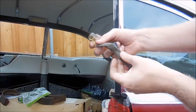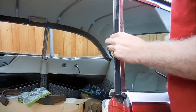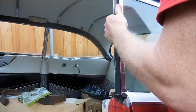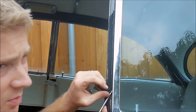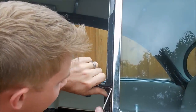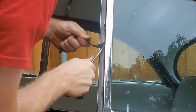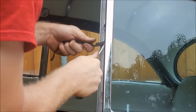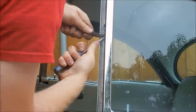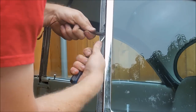The thing about this weather stripping is a lot of the original stuff came backed with fabric - I don't know why. The roof rails did the same thing; that's just how they made it back then, I guess - Cadillac quality. It's a lot harder to get out than I thought it was going to be. Most of the other weather stripping just kind of crumbled and fell apart. I'm just working the screwdriver back and forth to pull this metal core out, because that's really all that holds it in. Once I get this out, you need to check these side edges for any leftover because you don't want those in there.